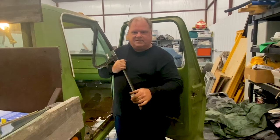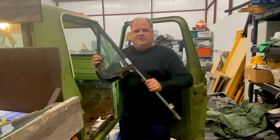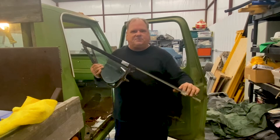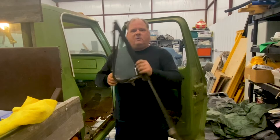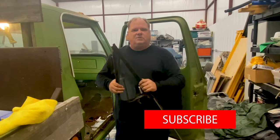As you can see, there was this little brace right here barely hitting on a piece of metal in there. There's a little access point in here that I'm sure, when it's lined up right, makes it easier to take out. That's how you take out your vent window. All in all it took about four or five minutes. Basically three screws, one nut, take off the window guides, and work it on out. I appreciate your time — please be sure to hit like and subscribe, and we'll see you on the next episode.